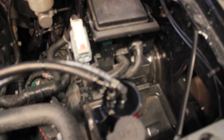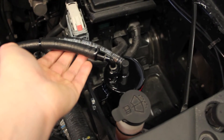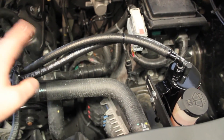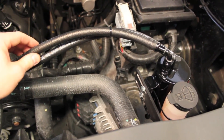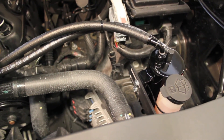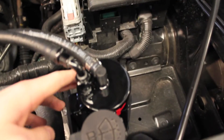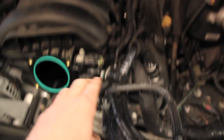My local store didn't have transmission line, which is better because it can take higher pressure — they only had fuel line. So I'm using fuel line temporarily and will order some transmission hose. I'd recommend using transmission oil line, or whatever you can find rated for really high PSI that's meant for oil. The fuel line is okay for temporary purposes, but over time it will begin to break down because it's not meant for oil and it's not rated for as much pressure. Anyway, you've got the can here, the lines going, zip tied there and there, running off to their respective places.